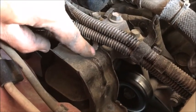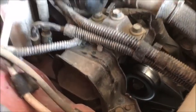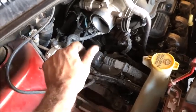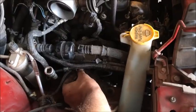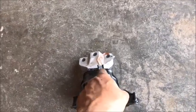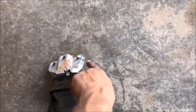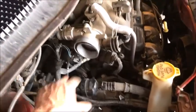You've got a couple of pieces right here on a clip — those pull right out. Use a screwdriver and pry right up underneath, same with this one. You may need a pair of pliers; these are little boogers to get out. Wiggle left and right as you pull up — don't just yank straight out or you'll rip the wires. After removing this ground strap, I noticed the new motor mount already has one on it, so we don't have to transfer it. There's rubber in between and you want a good ground connection — good ground is very important to these engines.